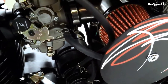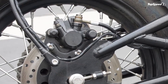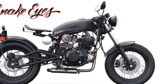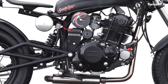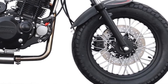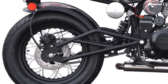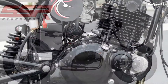Drivetrain. Simplicity extends into the engine as well, with a good old carburetor and capacitor discharge ignition. The one-lung thumper is as basic as it gets, with cooling fins to radiate waste heat and a 26mm CV carburetor to control induction. A time-tested capacitor discharge ignition manages the spark with nothing from the electronic wizardry shelf to complicate the works — but who would want traction control and rider modes on a bike like this anyway?